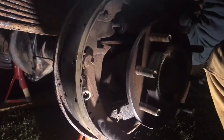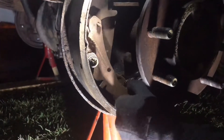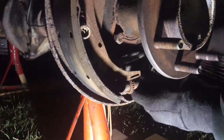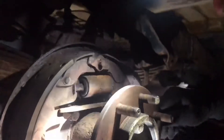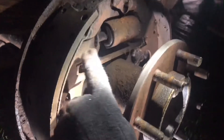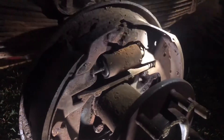Right in here, see this little tab thing — there's supposed to be a spring there. That's no bueno. There's nothing to push this back. It basically helps for holding this on to the adjuster, which is pretty much rusted to both pads. So we're going to fix that with some new parts. And up here, there's a bar with a notch that fits over this tab — that's where it's supposed to be, not inside of here. That's also going to be fixed. Hence why we probably had really bad braking ability.